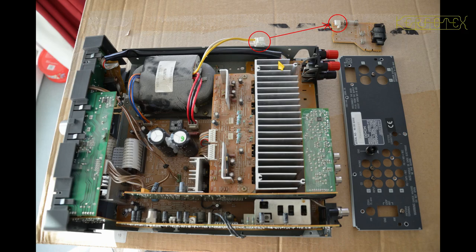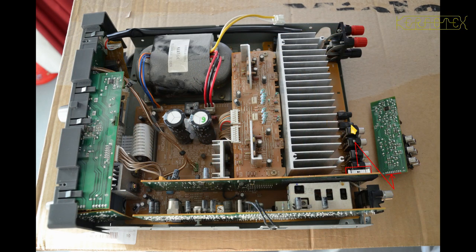The headphone socket lead connects to the speaker output connectors via the baseboard traces. The next board to move is the CD, phono, and aux input daughter board. Once you've taken the back plate off, it's just hanging by its connector. Be careful with it — there's nothing else holding it up. Just wiggle and pull it away; it'll be a little stiff but will come away.